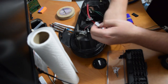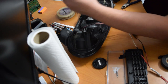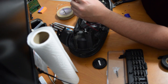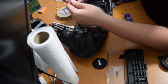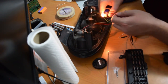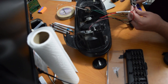This cable is pretty long — I think I will cut it down a bit to make things easier when we do the wire tuck. I mean, this thing's over a foot long. I'm doing the bronze copper color to the negative and the silver is going to go to the positive. Oh, I made a mistake — I forgot to connect my negative up to the other negative here. So back apart we go.